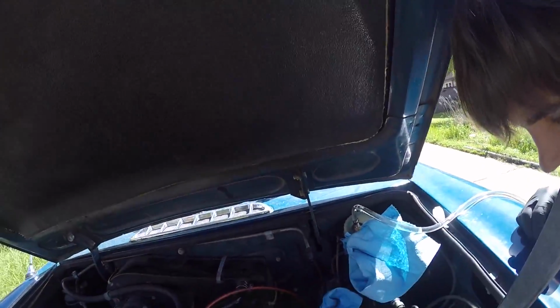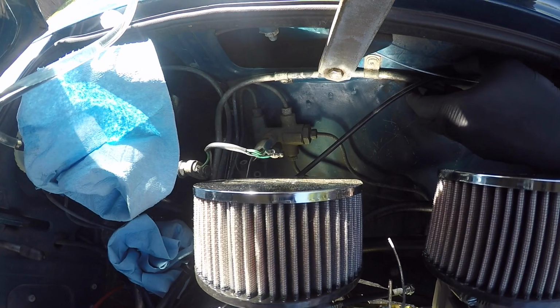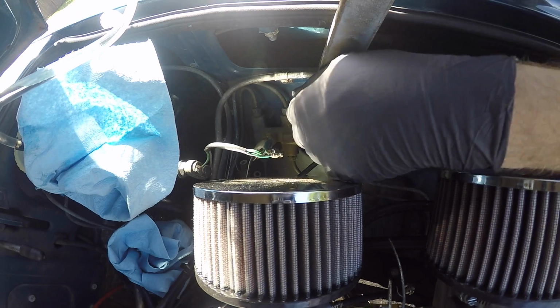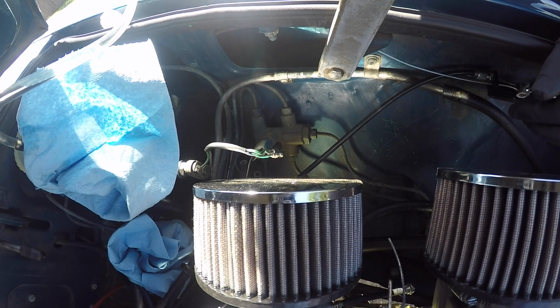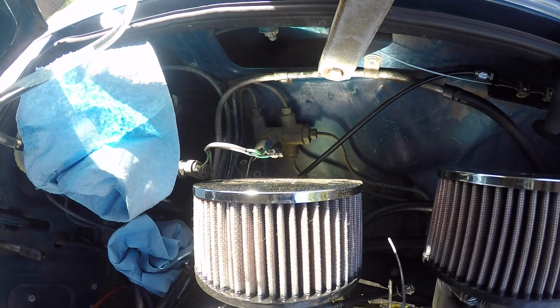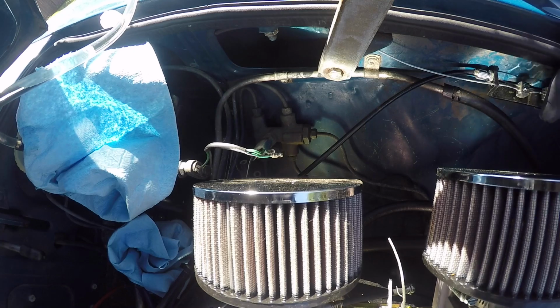So yeah, what he was saying at that point was, when this happens, sometimes what can happen is, here's a proportioning valve here. There's a little piston that slides back and forth to do the proportioning, and sometimes it gets bottomed out on one side or stuck or something like that. So he said to bleed, you know, just loosen the pressure off one side and let the fluid sort of spill out past there, and that sometimes makes the little piston slide to where it should. I forget which one is which though. I mean, I know which side goes to the rear brakes, but I forget which side he was saying to let bleed. So I'll just try both and see what happens.